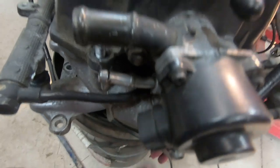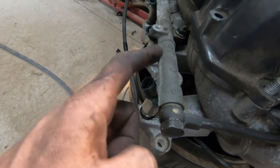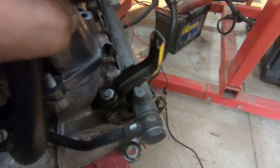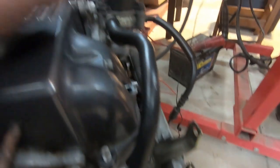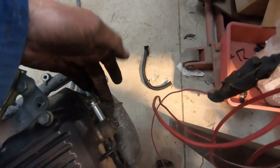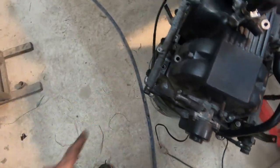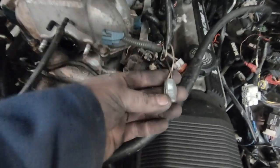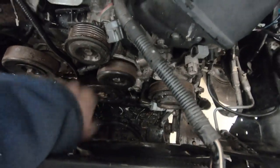The lower manifold has got the Gen 2 fuel rails - the round cast fuel rails - and it's got the Generation 2 bracket for the diagnostic. But it's had the Generation 2 EGR put on it, and there's a cold start injector - so that is a Generation 1 top, Generation 2 bottom I'm picking. So Lexus 2-pin connector. It would have had a fan idler on it but it's actually had the hydraulic pump with a different idler put on it.